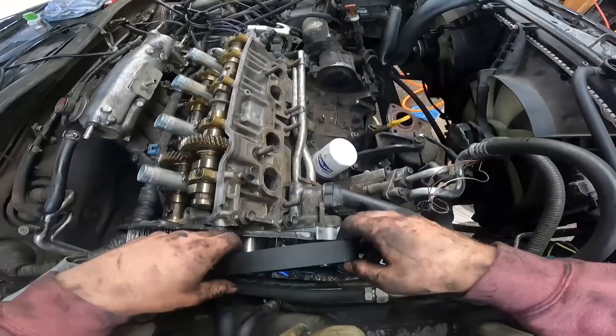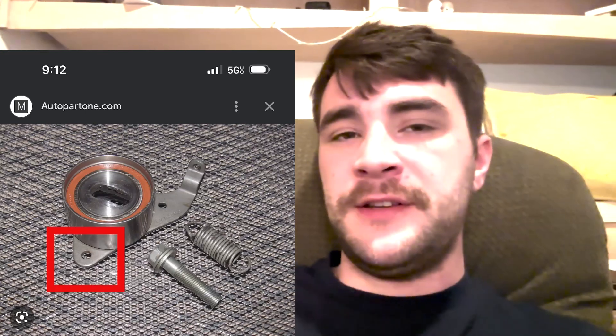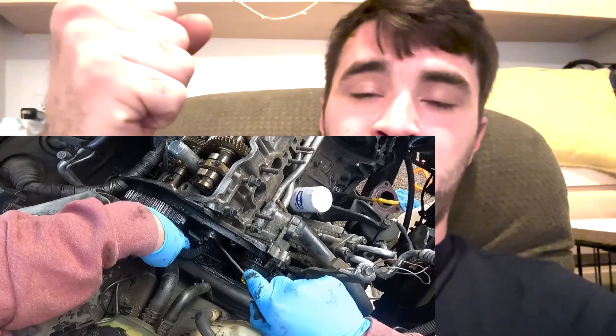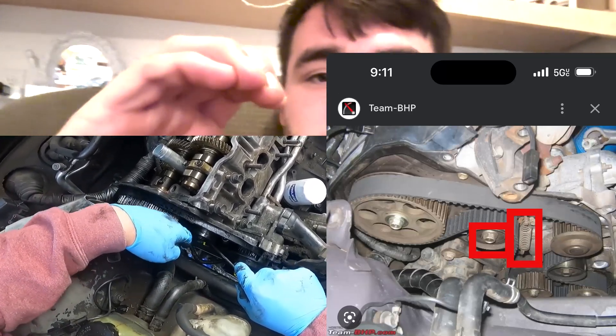So I'm editing part two of this timing belt video and realized I didn't get adequate footage, so here's the explanation: get the bottom half of the timing belt routed over the crankshaft pulley and over the oil pump pulley, then leave the top part loose. Put the left side of the tensioner onto the pin, start the bolt through the center of the pulley, take the spring and stretch it onto its pin. Use a screwdriver to shove down on the outer lip of the pulley to stretch the spring out, then tighten the bolt to lock it in that loose position so you can slip the belt on and off without too much tension. Once all your timing marks are lined up, back out the tensioner bolt, let the pulley snap onto the belt and apply tension, then lock that bolt back into place — and your belt will be tensioned.